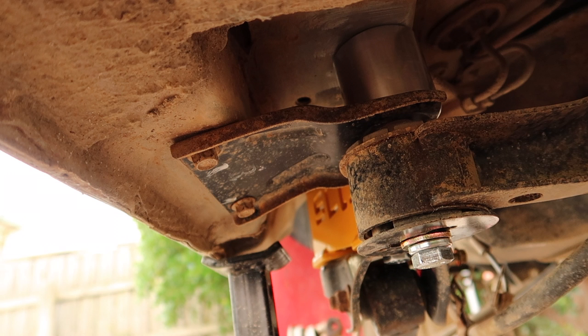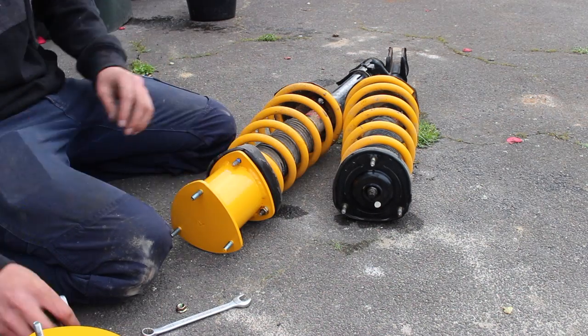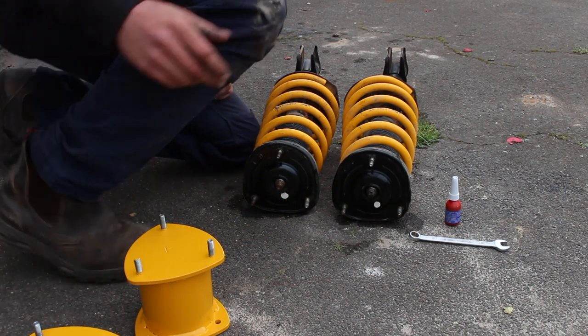I had to remove the massive washer from the top of the outrigger bush to the bottom. With all subframe spacers fitted, torque bolts as per instructions. Fit the rear strut top spacers - there is an L and an R representing left and right, so make sure you fit the correct spacer to the correct strut.